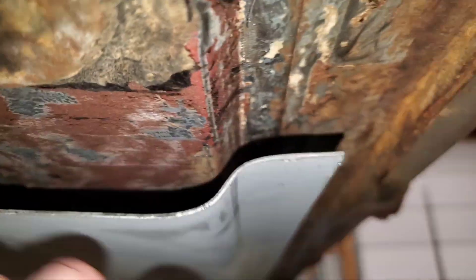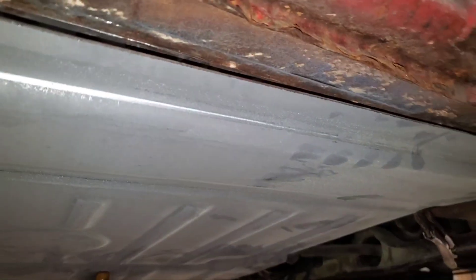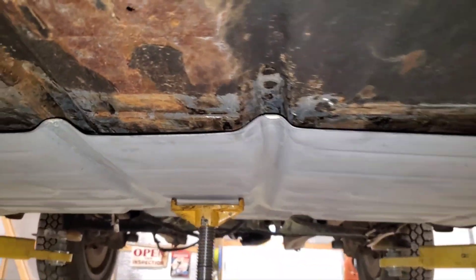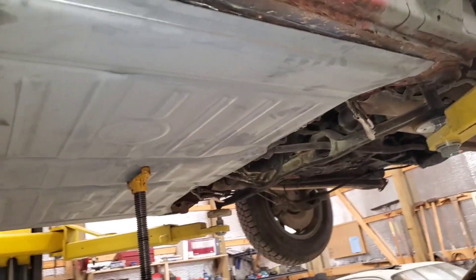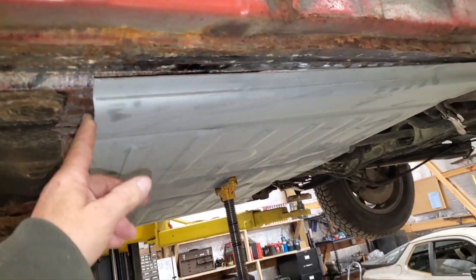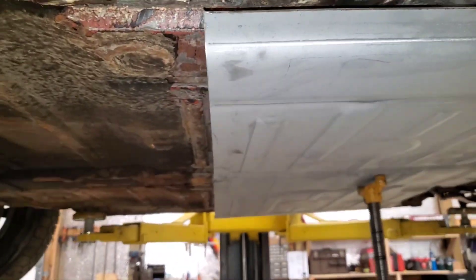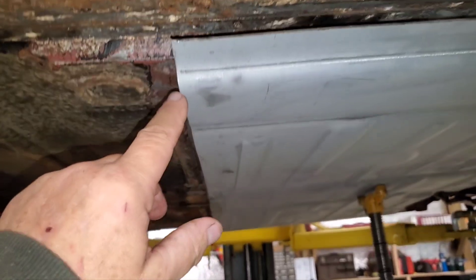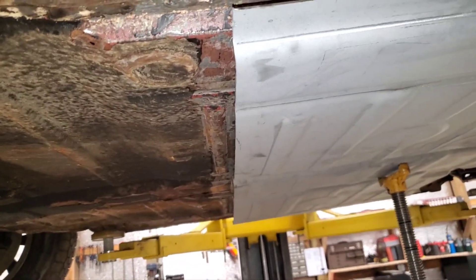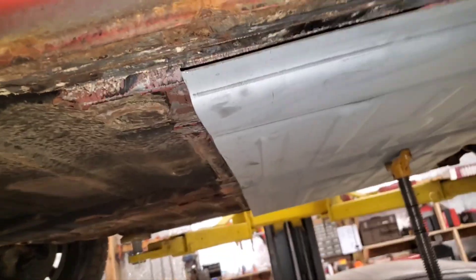Same thing over here - there's extra metal and it's just going to help that longitudinal, which we all know has rust inside of there. More metal, more time to enjoy the car before it disintegrates into a pile of rust. So I'm just going to score or mark this - that'll be my line where I stop removing the offending metal. I will leave at least a half inch for a final cut to tune it in precisely, but at least I can get a rough mark for now and get rid of the rest of that offending floor pan and the cross member, and then clean the tunnel up.